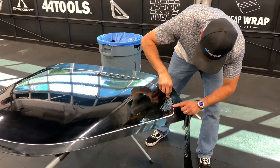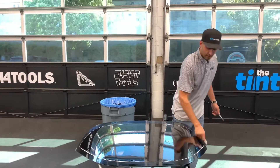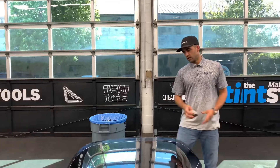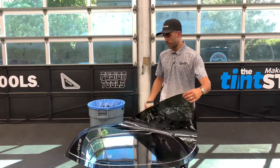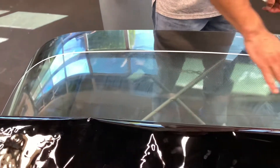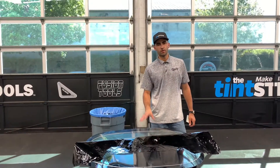For anyone wondering, I have all the hardest windows — the ones I believe to be the hardest — and I got them all from the local junkyard. It's a great place to get glass to practice on, or if you're training guys and you want them to practice versus practicing on a car. As you can see, we've got it all the way shrunk, definitely ready for install. Just because I showed you how to do it doesn't mean you're going to be able to do it the first time — it takes practice and discipline to stay out of the areas that are tempting to shrink. If you get this car and you're not able to shrink it right away, the option — and most customers like this option even if you can do it all in one piece — is to shrink everything except for the matrix area and just black that out with matrix. As always, you can DM me or comment below and I'm always happy to help. If you're in a pinch and need help, please contact us. We'll see you on the next video.